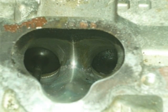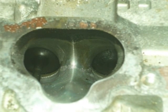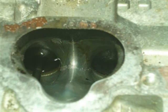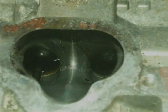You can see only one valve is opening because this is a variable valve timing engine. Let's try the bubbling test again — no leak on this side anymore. But I still have a leak on the exhaust side, so I'm going to do the same test on the other side.